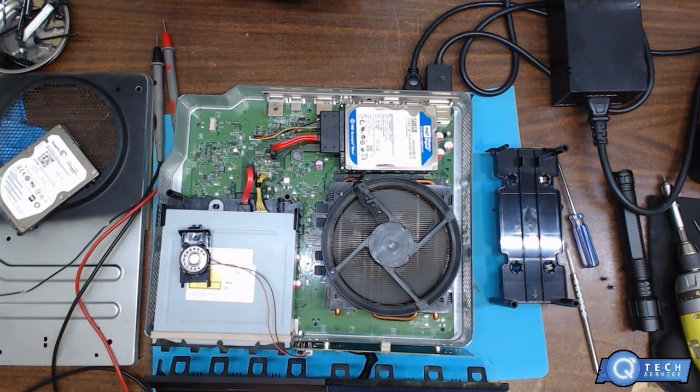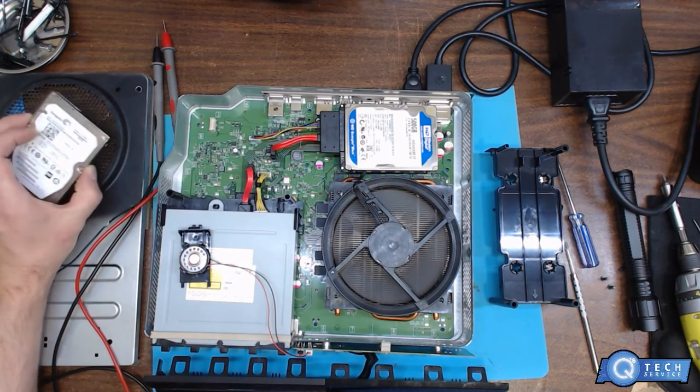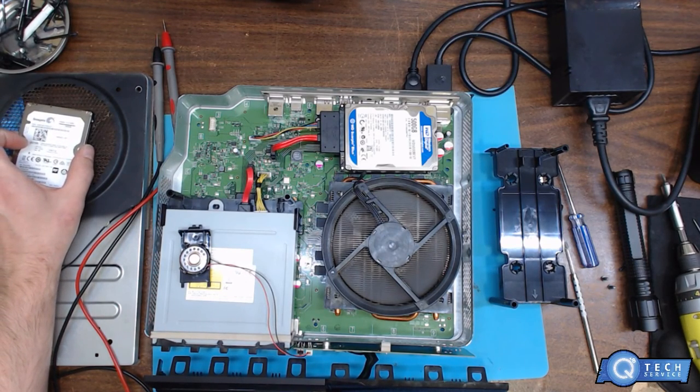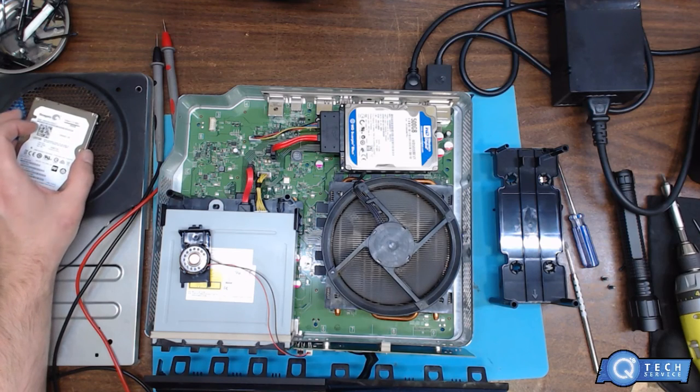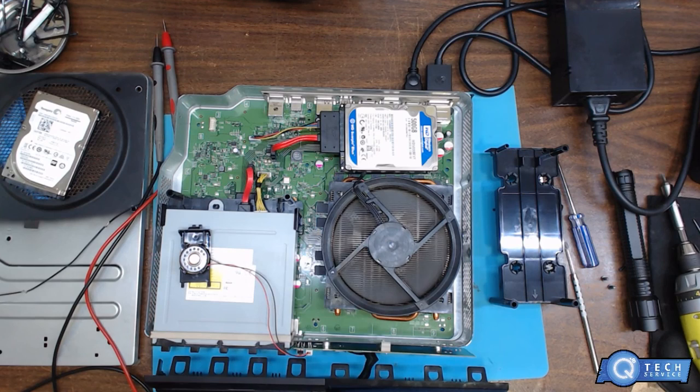So I'm not going to show you guys the boring video of installing the software. It's a long process. You got to make multiple different partitions on the drive with the operating system on it. So hope you guys liked the video. The whole time this was the hard drive that was failed. I heard the buzzing noise just very slight, like. Check the voltage, getting the right voltage, put another drive in it. And the system actually booted up now, so I got to reinstall the software on it.